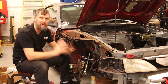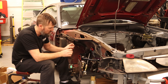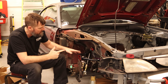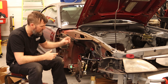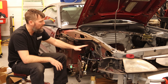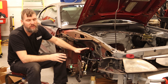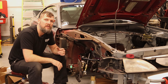I think I've covered enough for now, but the suspension is moving up and down and doing pretty much what I had designed in. Recap: I put in the lower control arm mounts into the stock K-member — now I have up to two inches higher with three holes. I built the lower control arm, all just tacked together but in there. The upper arm is unchanged from before, just with the spacer added for controlling camber. There's more to do, but we'll cover that in a later video. If you want to see that, hit the subscribe button — thank you for watching and we'll see you in the next one.